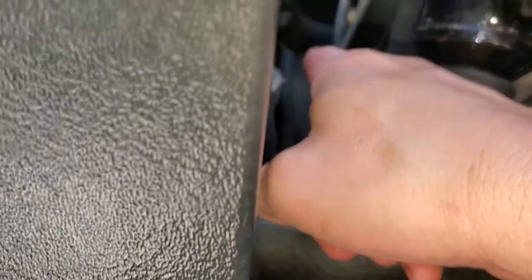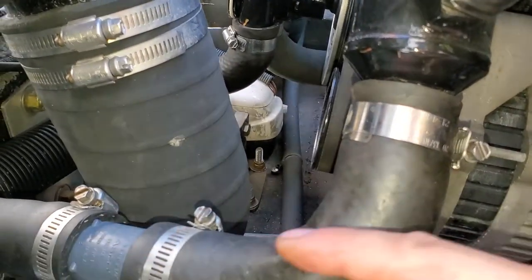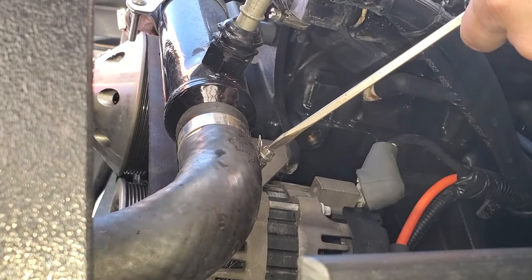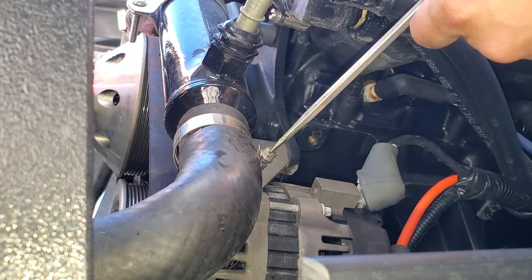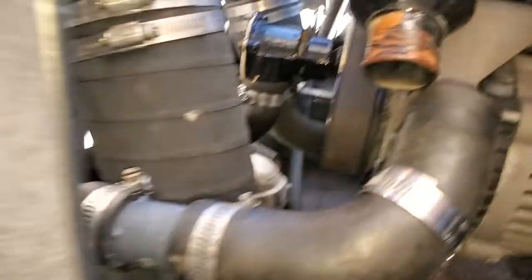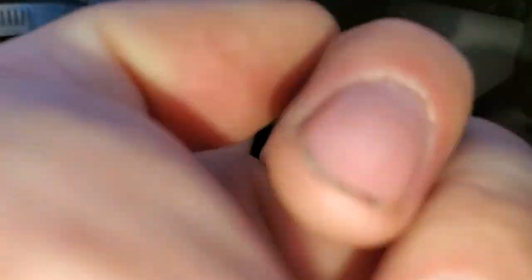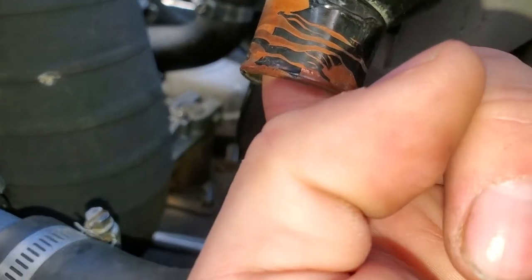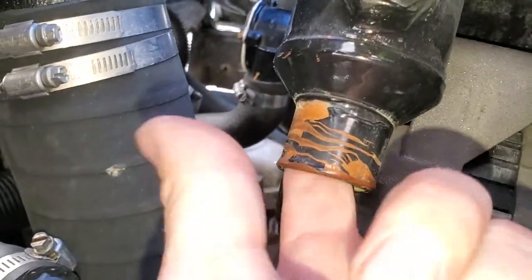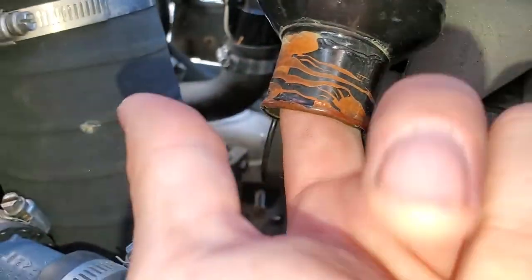If we move just backwards a little bit near the alternator, we're going to remove this hose clamp and the raw water pump hose clamp right there — it sits a little bit lower than this one does. We're going to reach a finger up in here and look for anything picked up over the last season. There's always stuff in here and that can affect your cooling. This is the best time to do it at the end of every season or more. Got that all clean now — pretty much comes out in one big chunk.